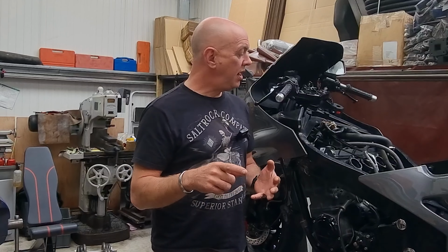So there is a fuel filter that goes from the pump up to the tank. I have had that apart, that wasn't filmed. There really wasn't anything in it. And it was only on cylinder 3 that it was failing. If it was dodgy fuel coming through everything, or sludge being dragged through or whatever, I would expect to see the same sort of problem on each carb. And it's not, it's just the one.